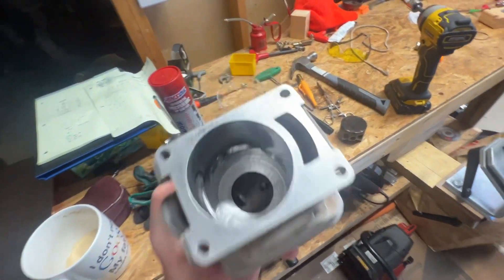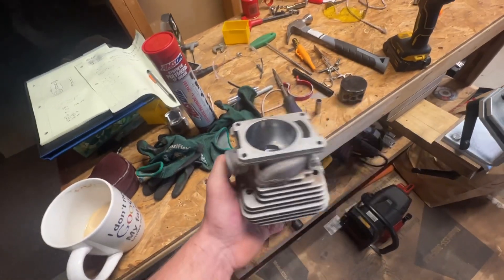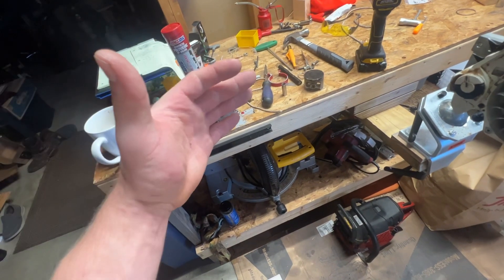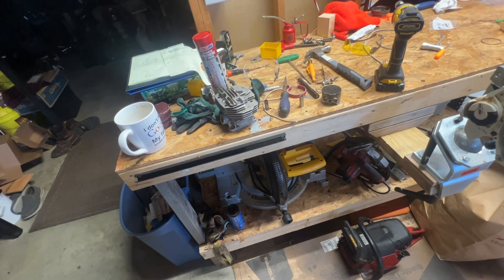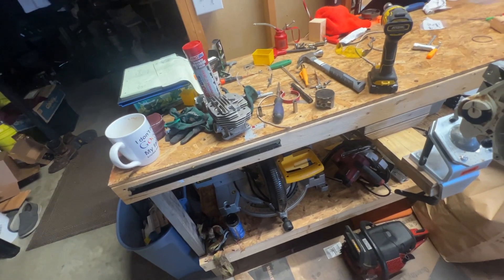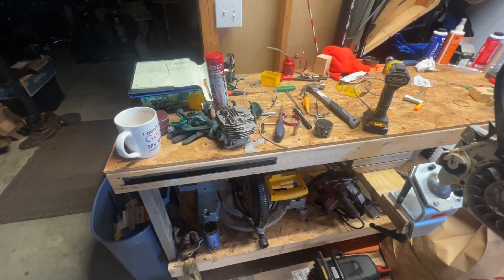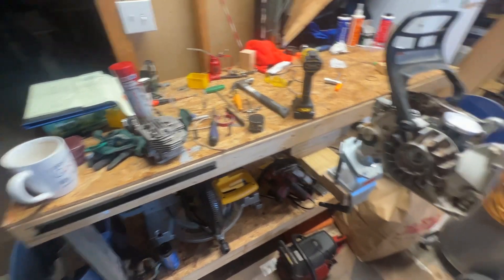If you flow water through your port and your feeds, you can see that the primaries don't even flow anything, so I opened those first to try to utilize them. Both of them have a good wrap pattern as far as how the water flows up the cylinder wall, so I left them basically alone — slightly angled up. I was hoping not to grind through like I did, but I did and had to put some JB weld in there to fix it. Hopefully this will last long enough for me to prove this is a viable swap.